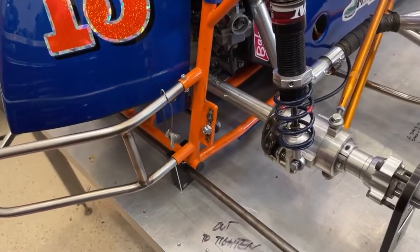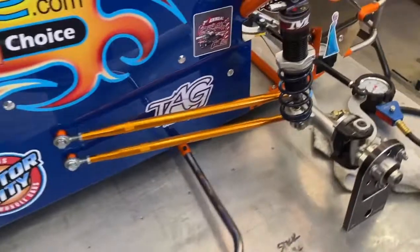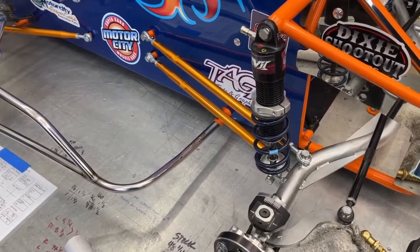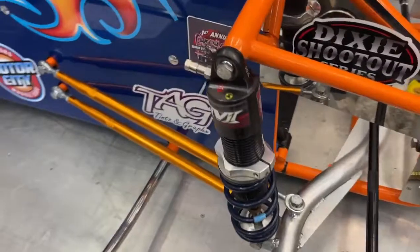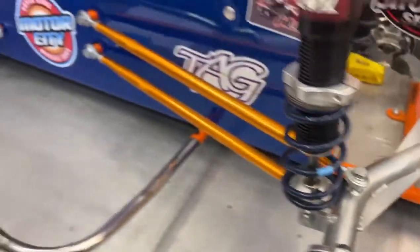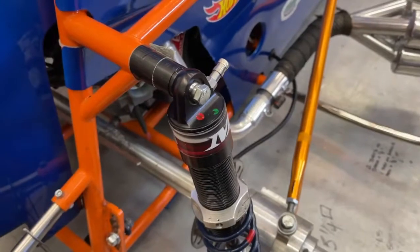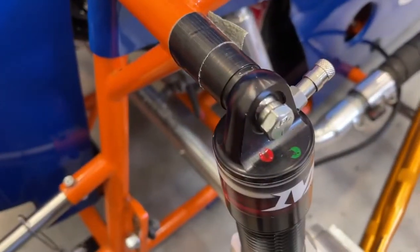There really is a procedure to doing this - you have to get everything done in a certain order or it'll take more time. The first thing we did was get our tires all situated for what we're going to run, we got the air pressures - it's very important to have the air pressures - and the next thing is we looked at our shocks. We checked the air pressure on our shocks; that's the ride height from the last race, which looks pretty good. This one in the right rear, also very good. We have a little system going with our shocks and springs - I can tell you exactly what that shock and spring is just by the color on it and the two dots there.